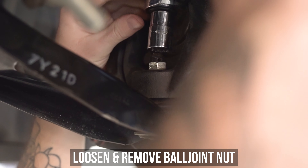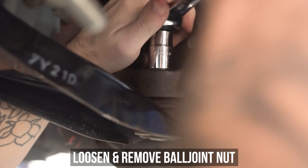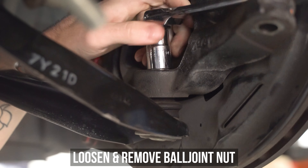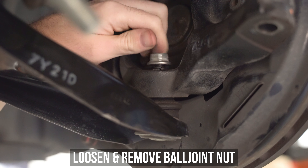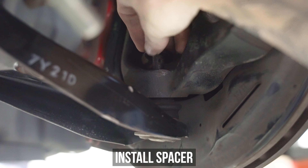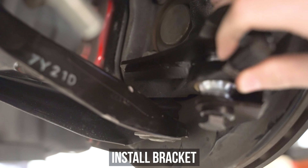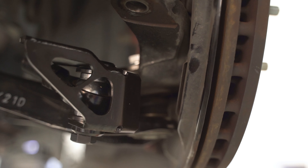Now head down south and remove the split pin from the ball joint — the super train can get this done in one fell swoop. Throw your ratchet on the nut, crack it open like your favorite barley pop, and wind it upwards. Then throw your ball joint spacer straight over the top of said ball joint — can't really make a mistake on this step. Put one side of the bracket up and over the ball joint thread and wind on the serrated nut.